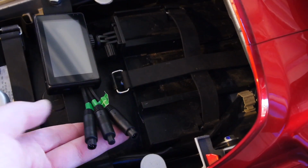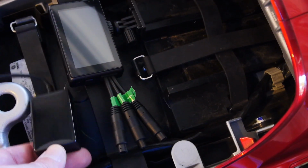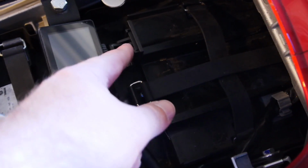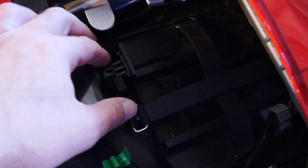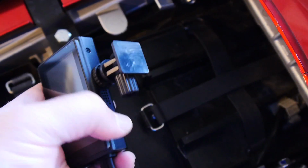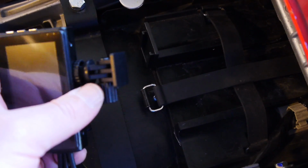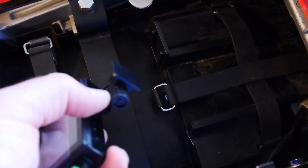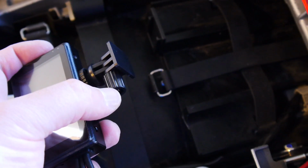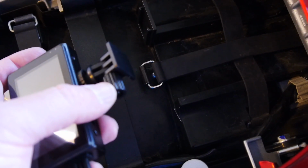So now I've got these 3 dongles and all the external stuff to fit. This little power module, that's not a big deal. This can just self-adhesive somewhere, and they do give you enough pads for that. Now this mount itself, at first I thought they just gave you a standard tripod kind of mount, which would make things maybe a little easier for some using a ram ball or something, but no, it's a non-standard screw. And even this little tripod, what looks like a tripod adapter, is not. First of all, this is not a tensioner with a normal screw control. There's a floating nut in here, so when you twist this, it just dials the nut in or out. So you can't take this out and back it out like a GoPro accessory. It doesn't work that way.